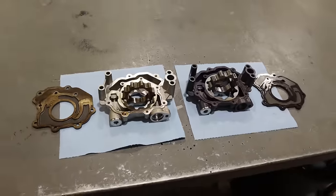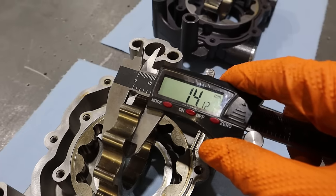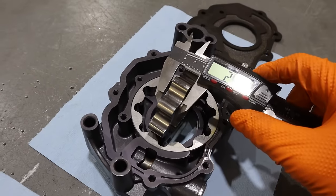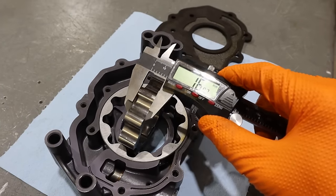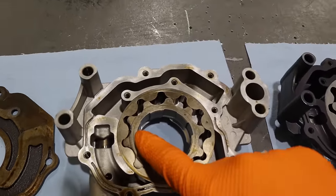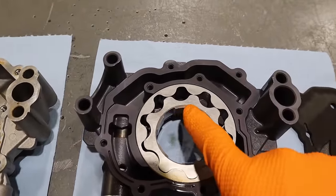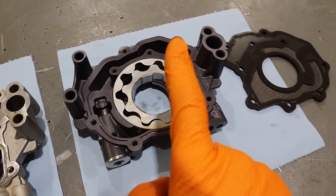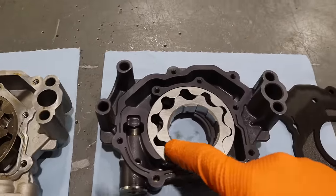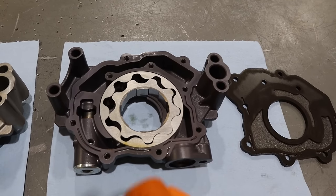However, that is not the entire story. As I've shown on my channel many times, the stock thickness rotor is 14 millimeters, and on the Melling pump you're looking at 16 millimeters — which is the same as a Hellcat pump. But that's not the whole story. If you look at the teeth on the stock 5.7 pump, notice how much smaller they are than the Melling teeth. These are very much larger. There is actually one less tooth on the Melling pump than on the 5.7 pump, however with how much larger they are, that in conjunction with the width of the rotor is how you're getting that full 20% increase.